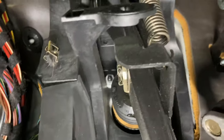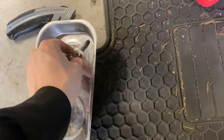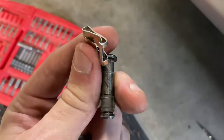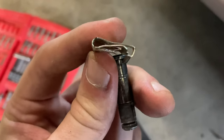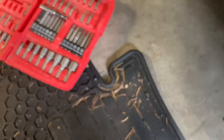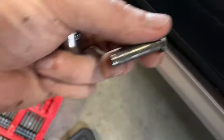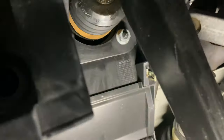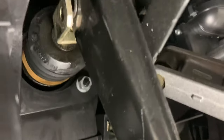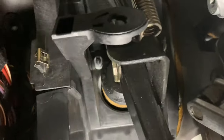I just released the pin for the brake booster. This clip is kind of difficult — you're supposed to pry it up on one side and kind of push this way — but we kind of broke it on one side, though it should still be usable. Once you get the clip off, push it towards the passenger side. Right there — the hole is connected to the brake booster, push it to the right. Now I'm going to get the three nuts off. There's not two, there's actually one up top as well, and they are 13 millimeters.